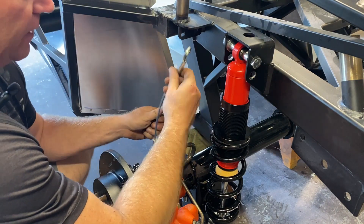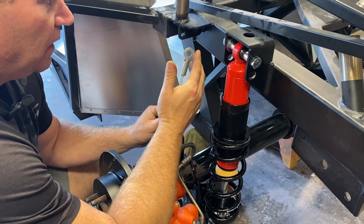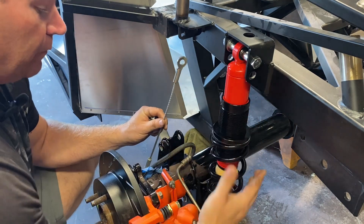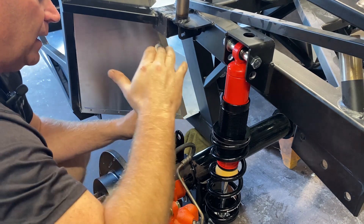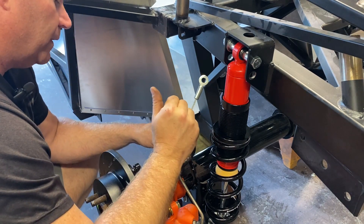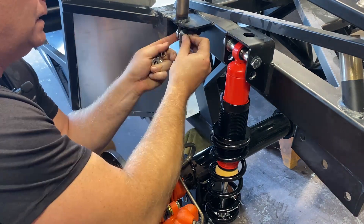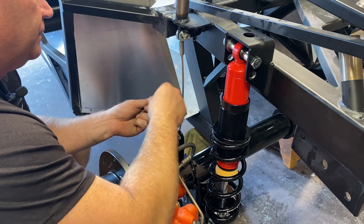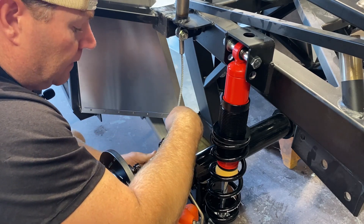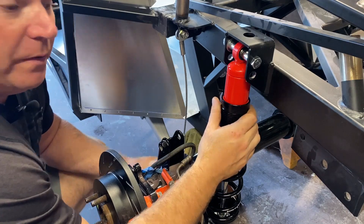Let's hook up the strap. The last piece of installing our solid axle four-link rear end is the axle strap, which is supposed to prevent the rear end from binding the driveshaft if you achieve airborne status. Right now with the jack removed it's at its bottom, so I want a little slack. I'm attaching it to the holes below where the roll bar goes, and the quad shock mount left on the rear end from the '04 Mustang donor has a couple holes — we'll use the bottom one for just a little slack. The hardware I'm using is the hardware that came for the quad shock mount since we're not using that. I need to open up the hole on the axle a bit because of the powder coating — then we'll get it mounted.